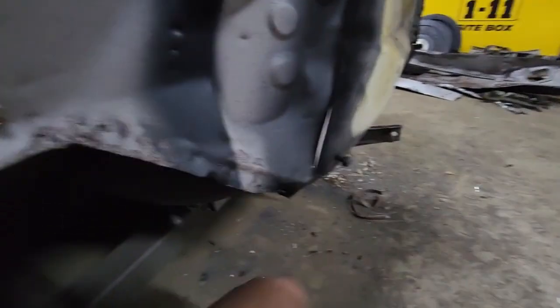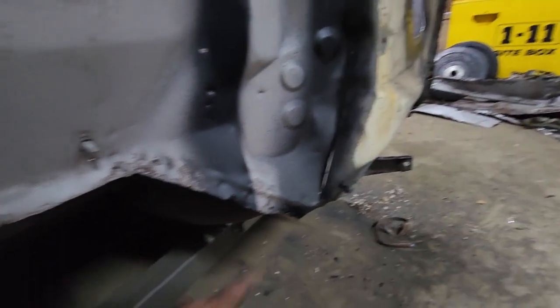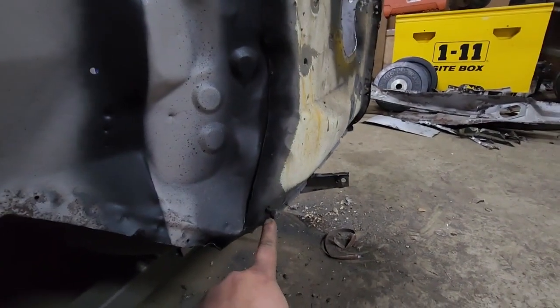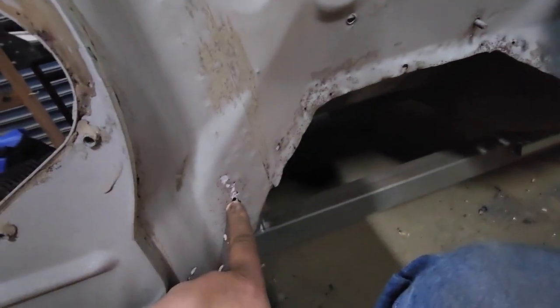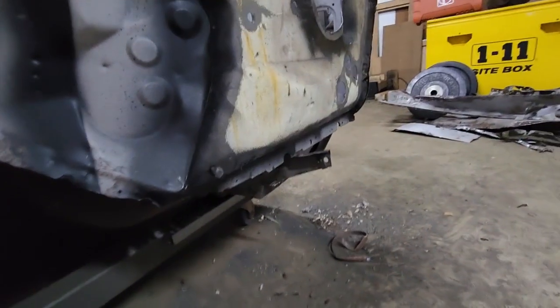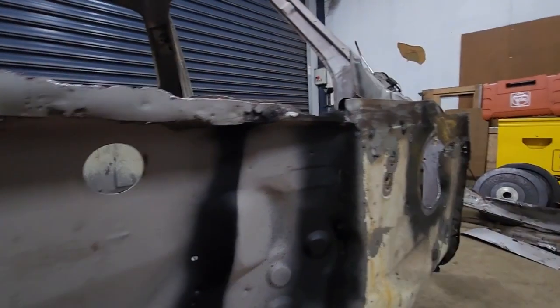I've got to do a bit of work here because this cab had been fucked with, so they've flogged in this corner. I need that bolt because that hangs onto one of the brake lines. The brake lines use that bolt. There's supposed to be a bolt there. I've got to come out of the master and weave along there and down. So I need that bolt. That's why it's cut weird, cut like a big triangle around the corner. But that's going to be about what it's going to look like, I think.